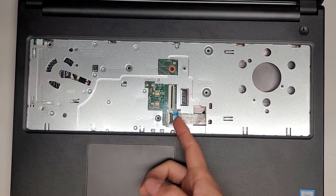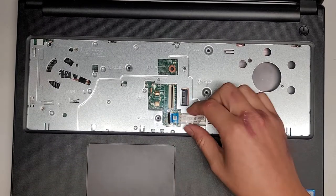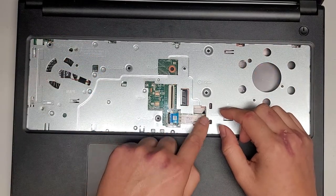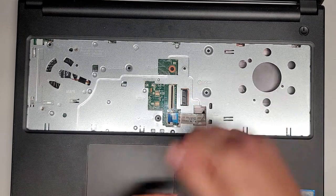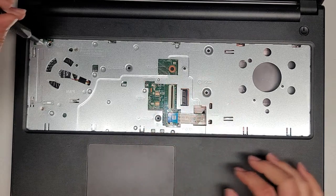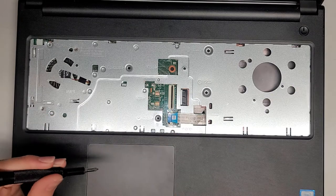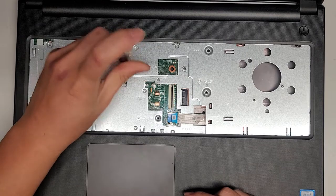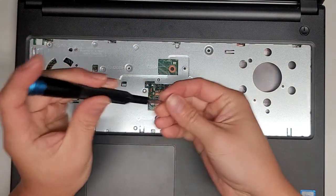You've got the connector here for the optical disk drive or CD drive — we're going to flip this up. You want to be a little bit careful when removing the cover because it will thread through here, so keep that in mind. Now let's go ahead and take all the screws out that are in here. These screws are different size, shape, and length from the ones on the bottom, so if you mix them up, you can damage your computer.